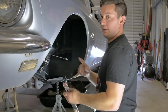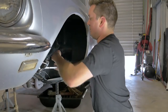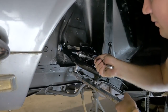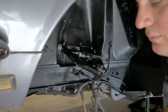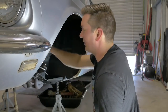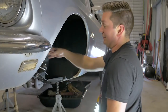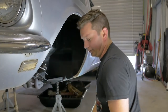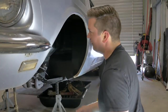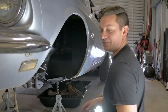Torquing these to 25 foot-pounds. See this thing pivoting? This comes pre-greased and uses a different kind of grease — supposedly you don't have to grease them for a couple of years. I've used this set before and never greased them; they are pretty awesome. Some of these don't get a lot of miles so it's hard to judge that.